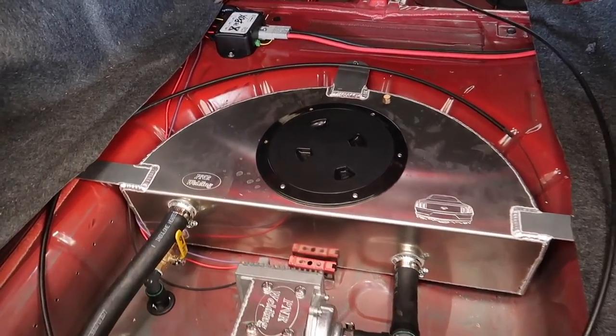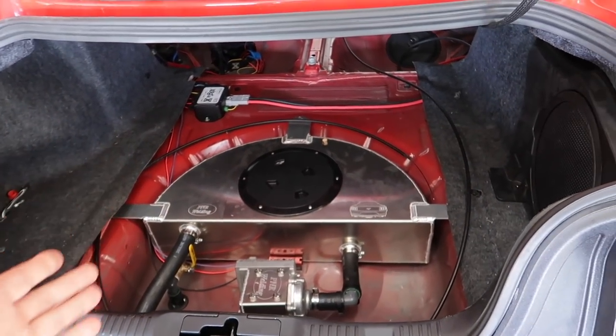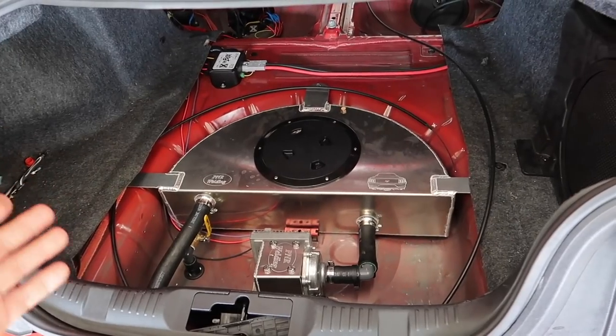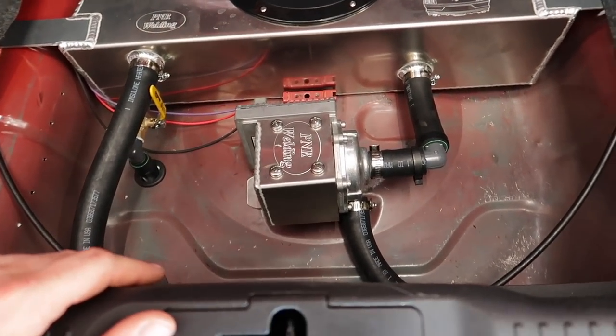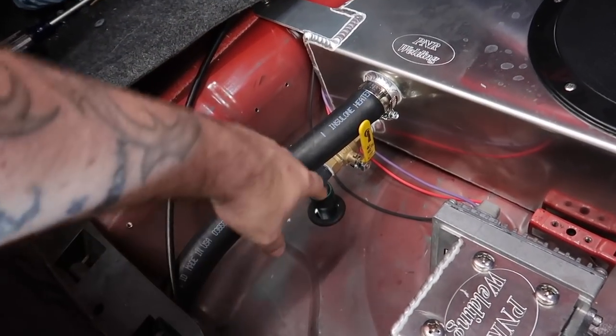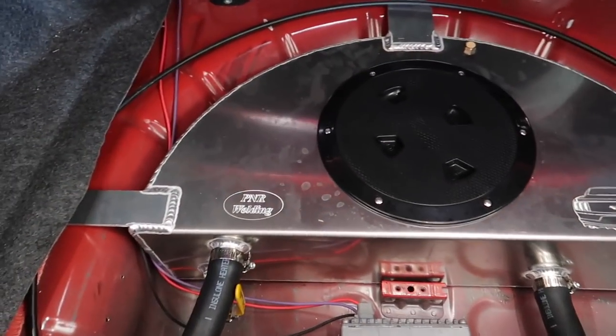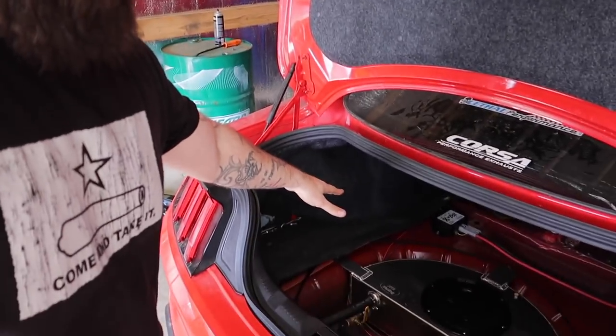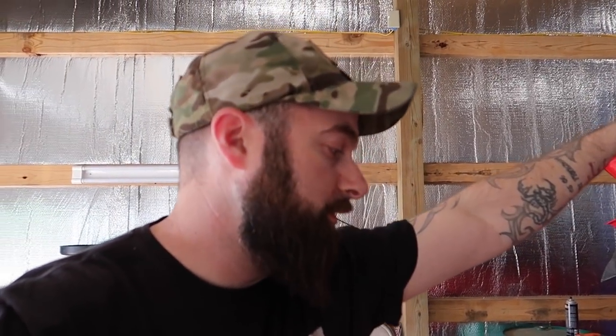We have a PNR ice tank — this is the big one. I reached out to Lethal and said, 'What ice tank are you guys running for mid to low weight? I don't care about the price, just sell me that.' This is what they gave me — the Stewart, I believe, level four pump. If you want to drain it, it's really easy — right there, just goes out underneath the car. This is how we run our line: you have your feed coming here and out there, then out through the sides, and then here's your return. Just like a return-style fuel system — kind of like the blood in your body circulating. This should help us with IATs quite a bit.